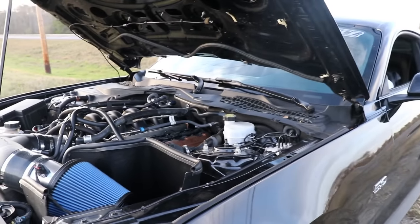It's an absolute beast with them. And paired with the Corsa Extreme catback, it absolutely rips. Topping it all off with the 47 pound injectors and the E85 fuel and tune from VMP, it makes great power all the way to redline. So to finish the day, we made 453, 399, and I couldn't be happier with the setup.